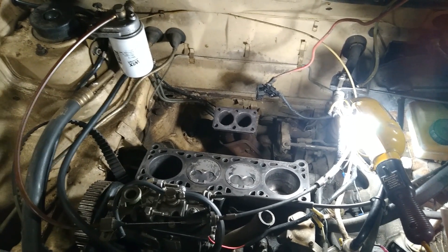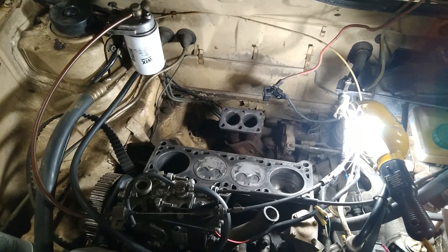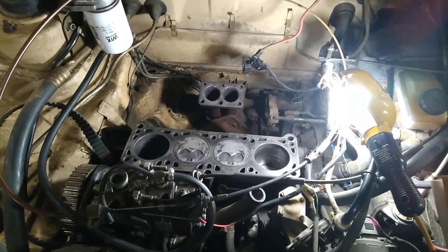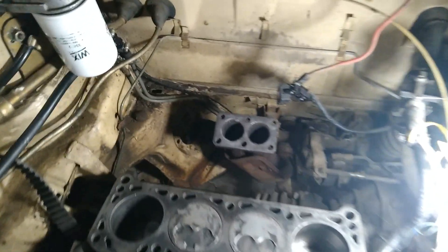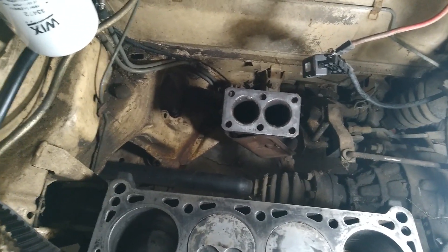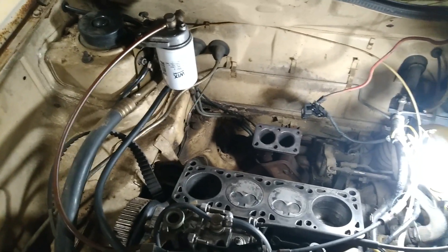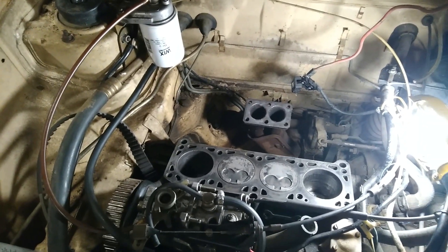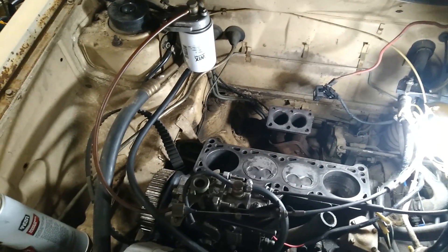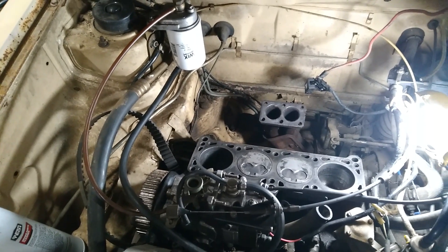The intake is held on with some Allen head bolts and it's just really hard — it'd be really difficult to get to those. So I took it off with everything, since I had to come in from the bottom and get the bolts out of the exhaust manifold. Two of them came out, four of them broke off, but they left enough stud sticking out of the exhaust manifold that I was able to use a couple of methods to remove them. Here's a series of little videos to show you what I did there.